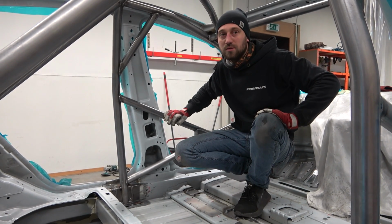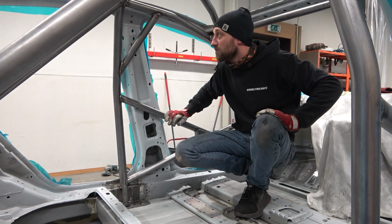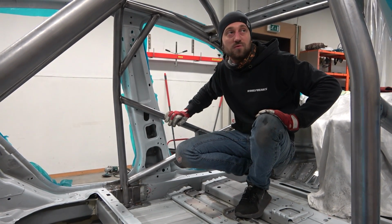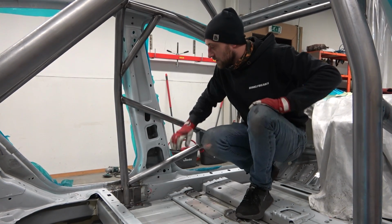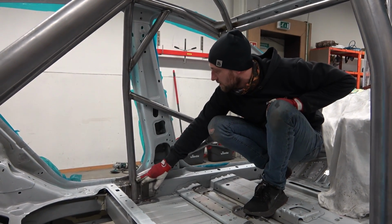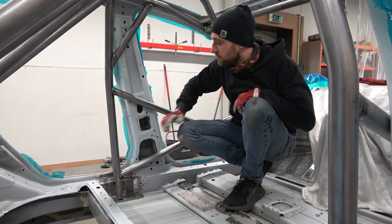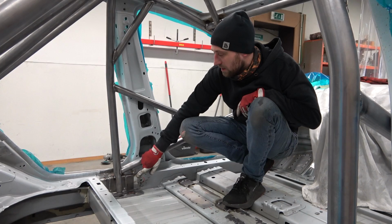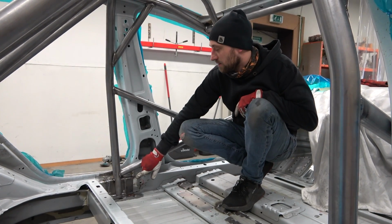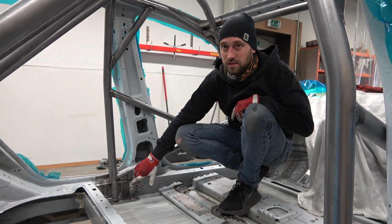It becomes smaller. Like you saw before in the video, when we spot welded the roll cage, it didn't move in the car, and now it was moving freely. So as you can see, here at the bottom nothing is welded and all the upper construction is fully welded. The last step is welding the roll cage to the car, so that there wouldn't be any stresses to the chassis and the car would be left straight, because it can be bent.